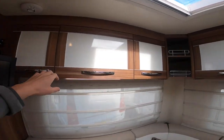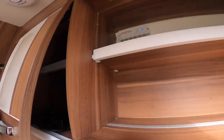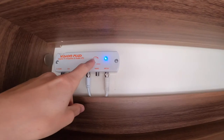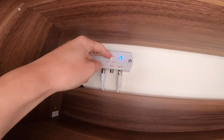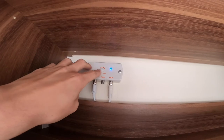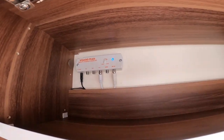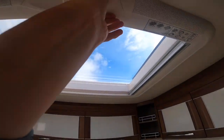At the back you've got storage along the top and in all the cupboards. Here is your Vision Plus amplifier for your TV aerial — if you're struggling to get a signal, control this button between min and max to get the right amplification for your TV picture. Sometimes if the signal is too strong it'll pixelate, and if it's too weak it'll pixelate also, so you may need to fiddle about with it.